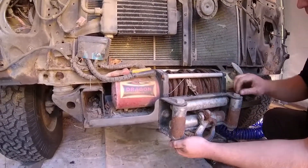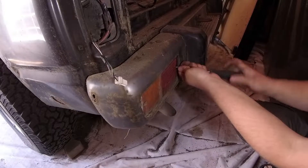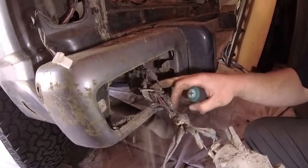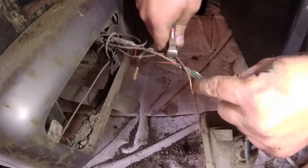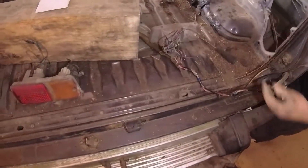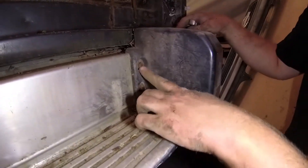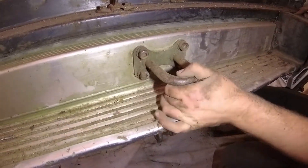Let's move on to the rear end of the car, so rear bumper. Let's remove these taillights quickly, just get them out of the way. That's what it looks like — everything is safe in here and I'm just gonna disconnect them all, figure it out later. Let's do the second one. So the rear bumper — I think it's from the outside, held in by one, two there, and four of these. Let's remove it and find out.